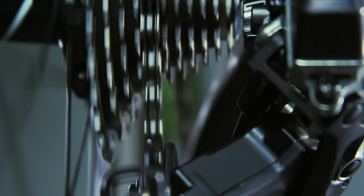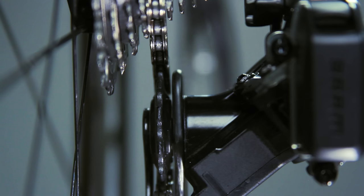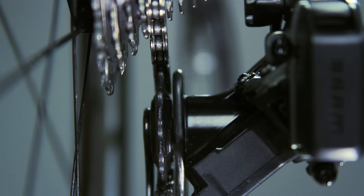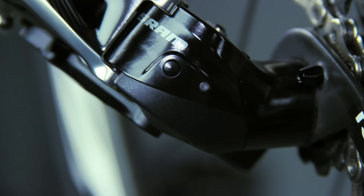Similar to a barrel adjuster on mechanical systems, unwanted rasping sounds can be eliminated by fine-tuning the rear derailleur shifting with micro-adjustments. To micro-adjust from a larger cog to a smaller cog, press the right shifter function button while simultaneously pressing the shifter paddle. The rear derailleur may not appear to move. Watch for the LED to blink to confirm the derailleur executed the command.